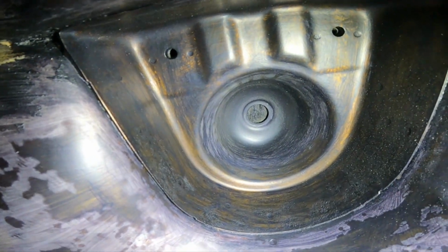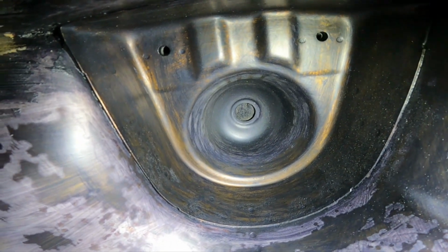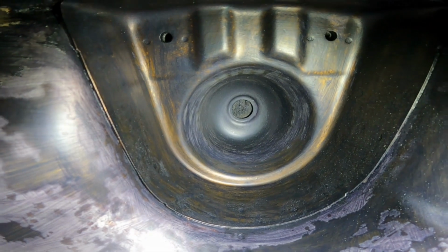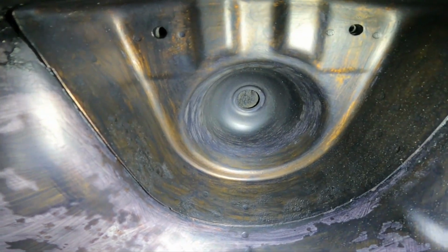Yeah, so up here in the suspension turrets, on the actual walls of the turrets, I don't know if you can see the pitting, but I've spent a lot of time getting the rust out of those pits as best as I can. And again, I know I'm repeating myself, but because you can never be sure you've got all the rust out, I've gone over it with Hydrate 80. So that's a good two coats on there at least, I think, so far, but I'm probably going to give it another one.